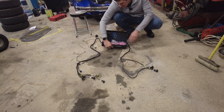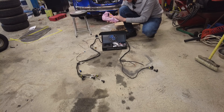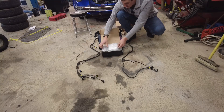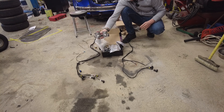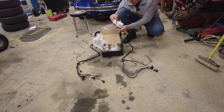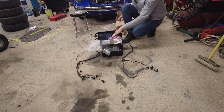Here are the brains of the operation — this is the ECU, a Max ECU Mini — and we also have our lambda probe in there. The throttle bodies are where your fuel injectors are going to mount and these are what replace the carburetors. One has the throttle position sensor on it. My existing throttle linkage and manifolds are what are going to be used. We have various bits of hardware including the ignition amplifier and fuel rails.